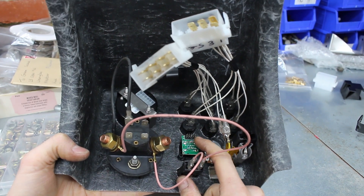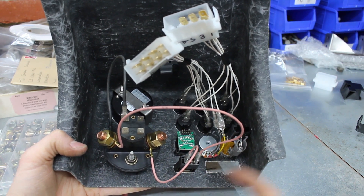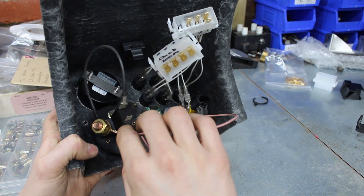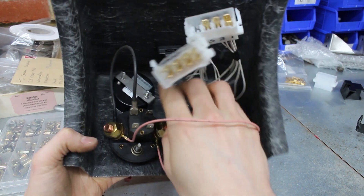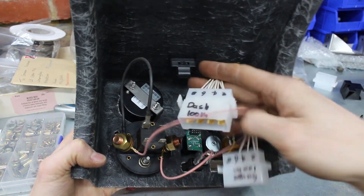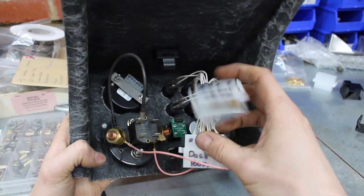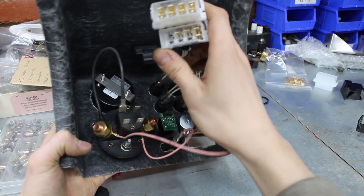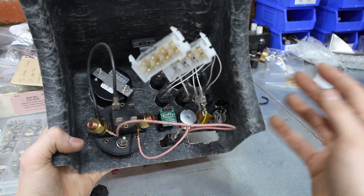The USB uses a standard 10-pin PC header with two pins for ground on each and a single pin for 5 volts. Then there's the loop from the fuse. The rest of the wires on the terminals are in the main dash loom with a connector going into the back of the gauge. The screw for the GoPro mount is actually the bottom of a selfie stick. The wires are separated into those integrated into the dash loom and a separate gauge-related loom which is completely separable. These are 6.3mm 8-way connectors — easy to put together with the right crimp tool and giving a really nice detachable finish.